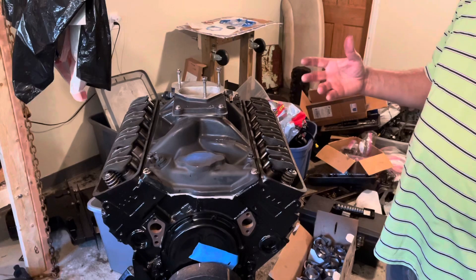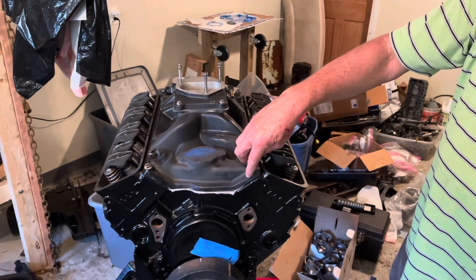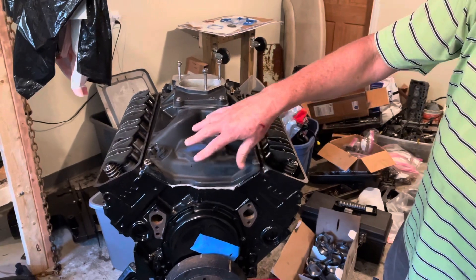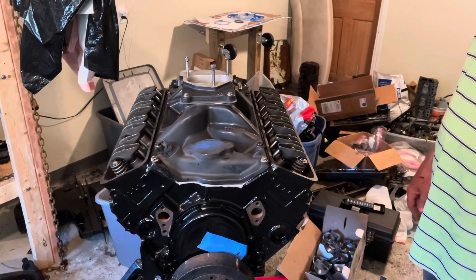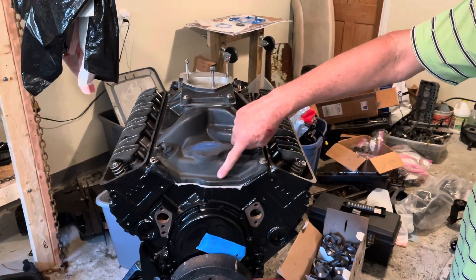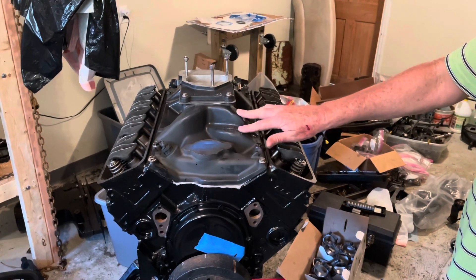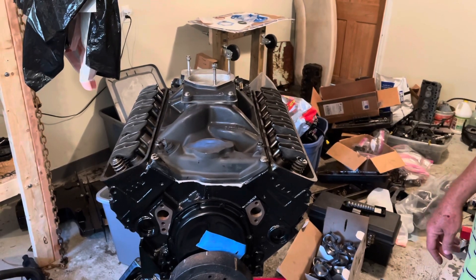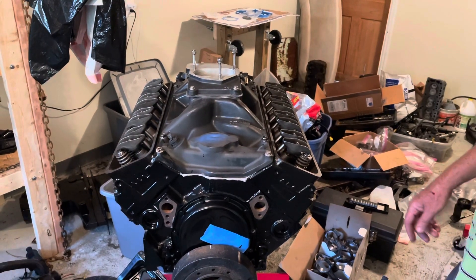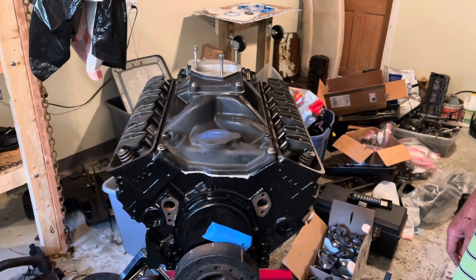The reason you don't torque these very high is: one, you don't want to crush the plastic intake manifold gasket in there — that's probably the main reason. The other reason is you don't want to squeeze out your seals too badly either. So this intake manifold is now installed and we're going to let it dry. I did paint some of this intake manifold because it had corroded, and the primer matched the color of the manifold already. I'm going to peel the tape off and get ready to put the rest of the accessories on this engine. So that's it for this video — thanks for watching, and if you found this video beneficial, please subscribe to my channel.